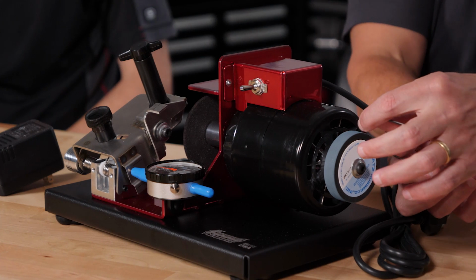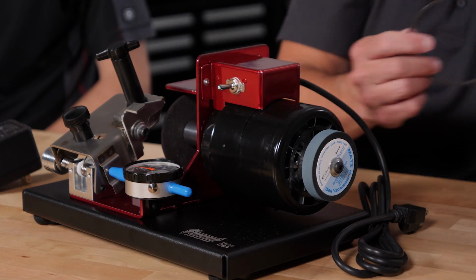Right. Any little burr, especially on the very outside of this edge, bites into your cylinder. It's going up and down at 7,000 RPM. It's leaving scratches all the way. It ruins the engine. So the deburring wheel that a machine like this has is great. Yeah, because once you've taken the ring out of here, spin it up, just touch it. You can deburr it super easy. And again, it's fast, it's precision, and it's the right way to do it, essentially. And with the steel rings, it's really the right tool for the job.